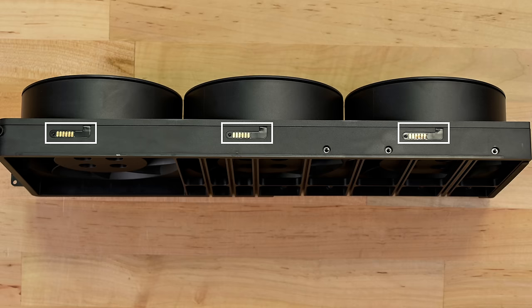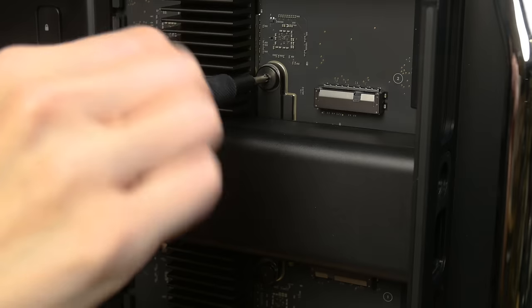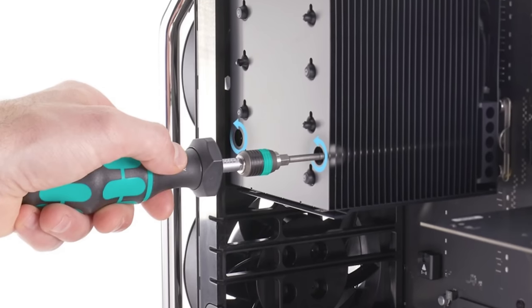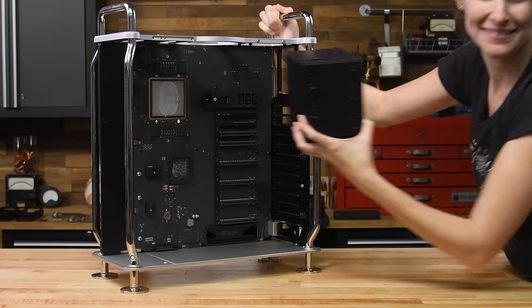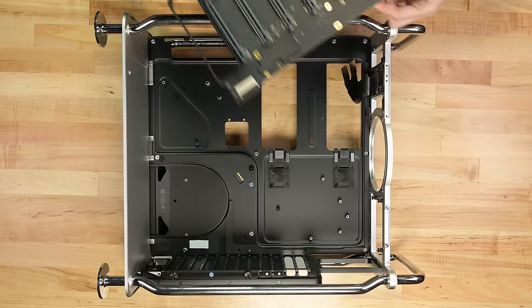The cable-free management in here continues to impress. Let's free the little speaker back here — it seemed to help last time. Our first cable! We can safely say this year's heatsink is a different beast. That's good news, because you no longer need an ultra-long driver to remove it, but it definitely took me forever to get it free. Screws, screws, more screws, some brackets — you get the picture. A little waggling, and the logic board is free.